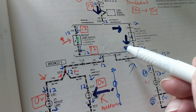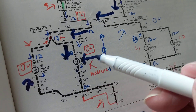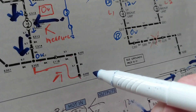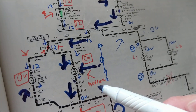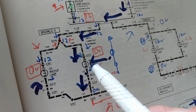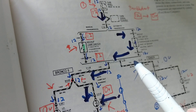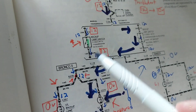One side of the fuse goes to the battery — not in the schematic but understood when it says 'hot in run,' we know it goes to the battery. The other side goes to a spliced wire, then to connector C156. For an automatic transmission we go through a switch, then through a black with pink stripe wire, and we come back up. So we trace: here, here, here — through the automatic transmission path — here, here, here. Current cannot stop; it has to have a full circuit. So we go to a ground wire — here's the ground symbol, here's G200.